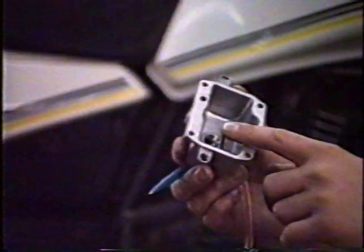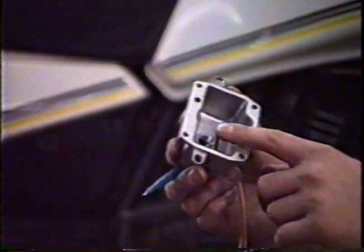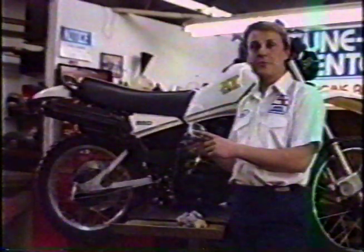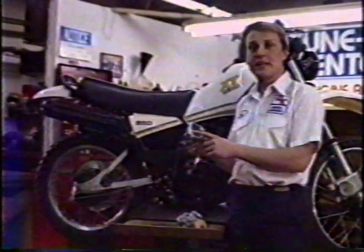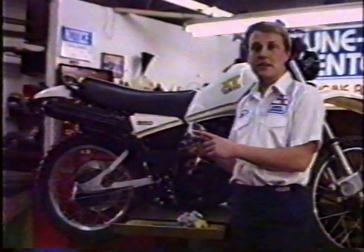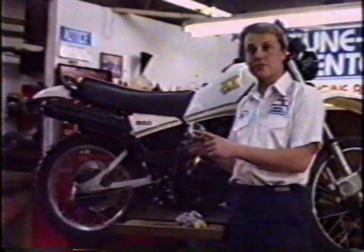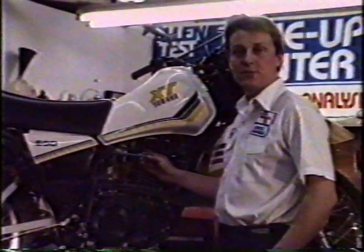This gets it to the front of the bike and out of the fuel, allowing you to take it further back without overflowing. If you find that you can't bend the overflow hose forward, you may be able to add a short piece of hose or pipe, such as I did on my 82 XL500. Again, the purpose is just to get the overflow hose farther out of the gas to the front of the bike.